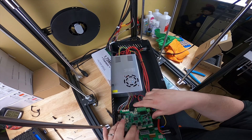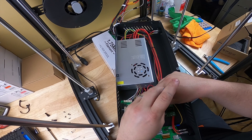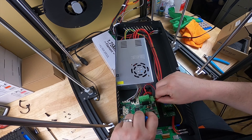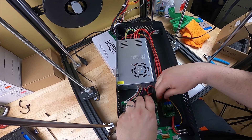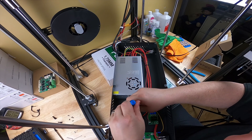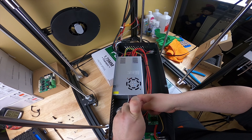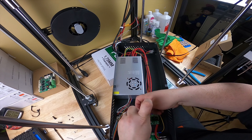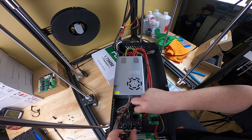What's left are the power wires - let's do this one first. This is the main power with 24 volt DC. These wires are tinned - I'm almost tempted to un-tin them. Just do a little snug tug on those to make sure they're all good. I don't love that connection but everything seems tight.